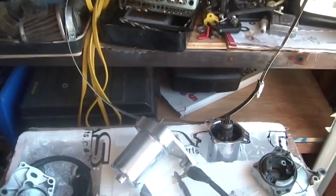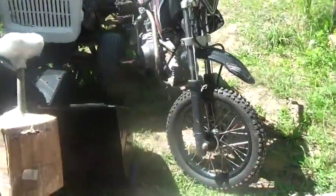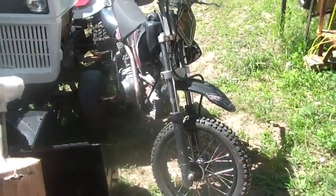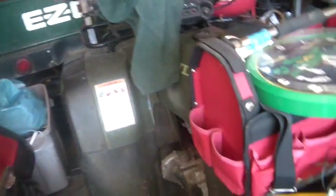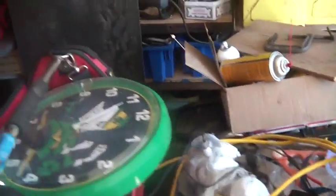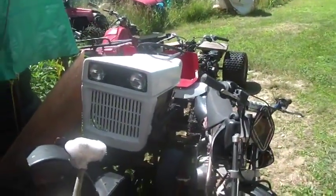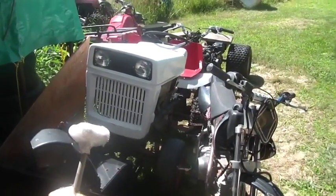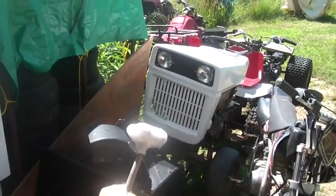When it comes to buying the Chinese parts for these Chinese quads, or China bikes and all of that, I've had pretty good luck with the universality of the carburetors. Basically, if they'll bolt on, they'll run. I have had some trouble with ignition pieces where the ad describes the ignition piece one way and you get another. Like I bought ignition modules that claim to be DC powered. Right, they needed 12 volts to make the ignition modules run, and it turns out they were not.